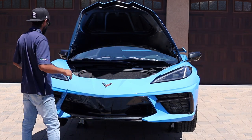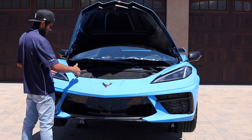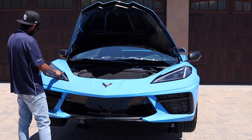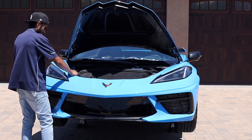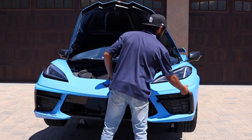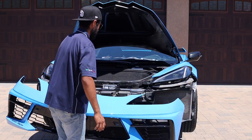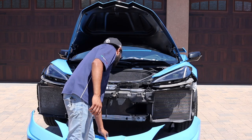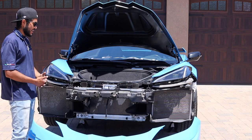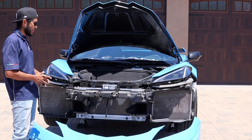The way to remove it easily is to lift up on the headlight to make sure it doesn't get hit, then pull out on the outer side of the bumper and slide it out of place. Go slowly, pull out on the bumper, and just like that you have your front bumper completely off the car. As you can see, it can be done with one person and it's really not that hard if you follow the correct steps.